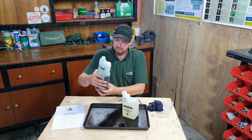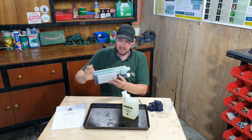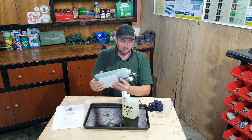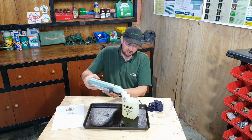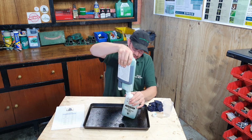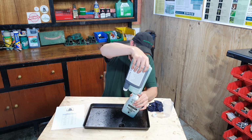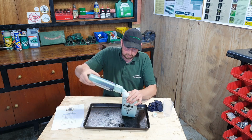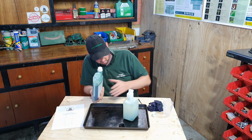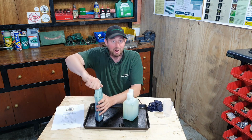Now to pour this, you turn it round, I think that way. That's it, and it causes an airlock now. So when we tip it up, we can't get any oil coming back up the pipe. We know that we've got just 20 ml in there. Right, and there we go. We tip that in. And that's 20 ml of oil mixed in with the fuel, which should bring us up, and it does. That was lucky, up to the 50-to-1 mark.